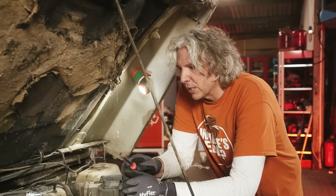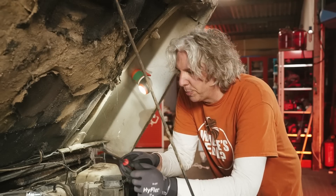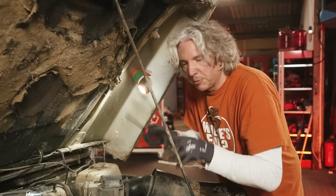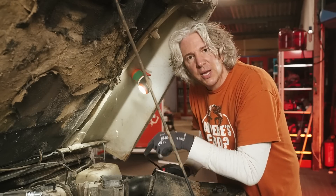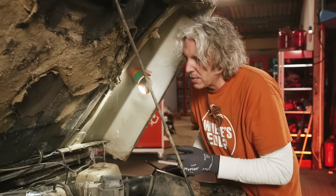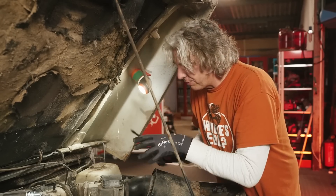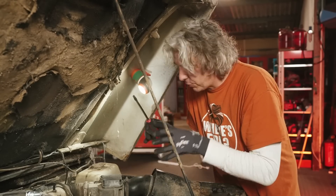What I'm wondering is we know the fuel pump works on the button for sure, but I haven't actually tested the fuel pump now it's reinstalled as part of the car. So even though we can hear it spinning up, I don't know for sure it's spinning the right way. What I'll do is crack off that fuel line again, pop it into a bottle, operate it from here, and see if we're getting some fuel.